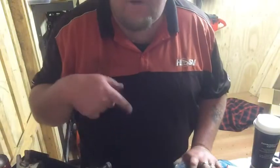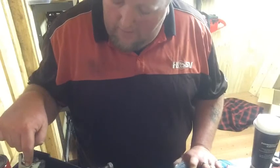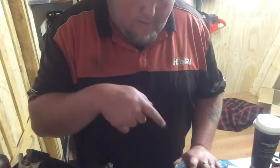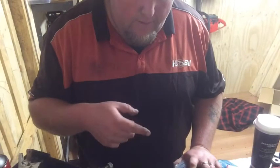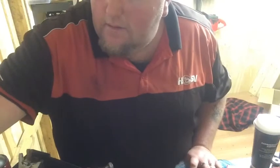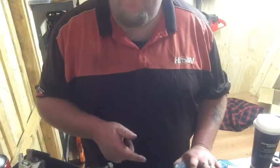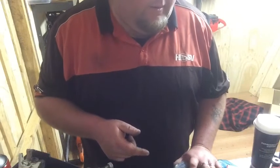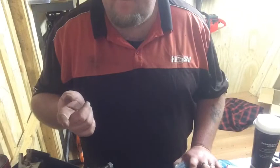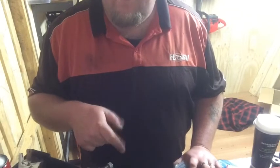So I'm cleaning the bench off, cleaning the cases for the 041 and all the other bits that are dirty. I'm just going to spray them with my dissolvent, let them soak for 5 to 10, hose them off, then I'll blow them off with compressed air, and then I'll sit them out in the sun, in the wind, to dry. I've got the night off.